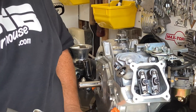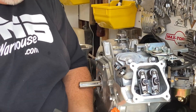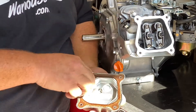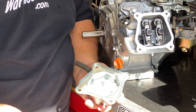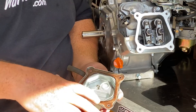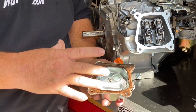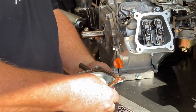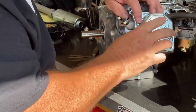This engine's never been run, and this gasket may be okay, but there's a different mating surface on the head versus on the inside of the valve cover. If you're going to reuse a gasket, just flip it over and give everything something new to bite with. I would prefer that gaskets are swapped out every time, but I know that we're not always doing that. So now we can put the valve cover back on.